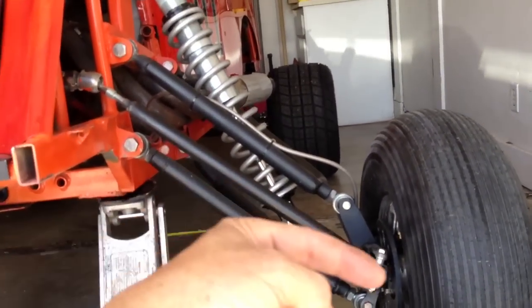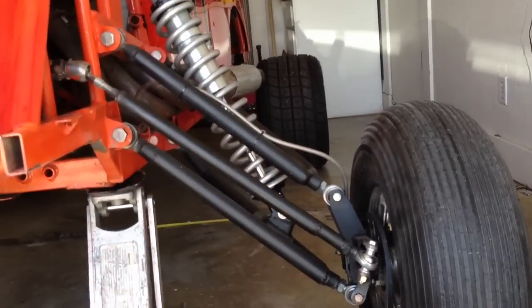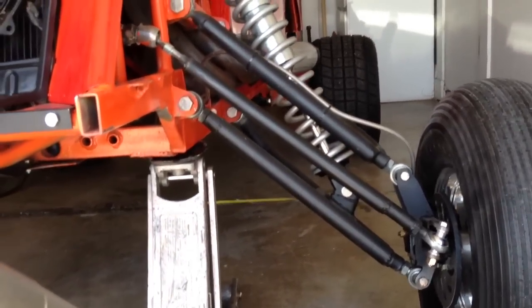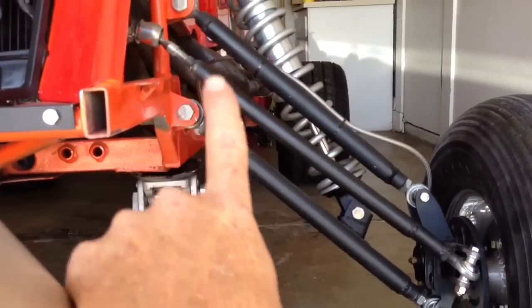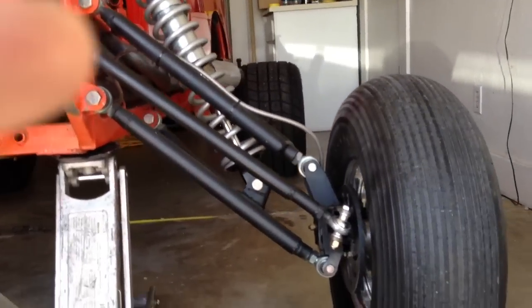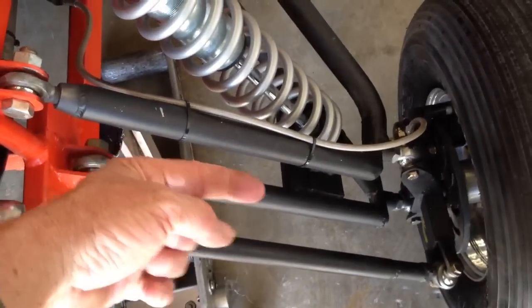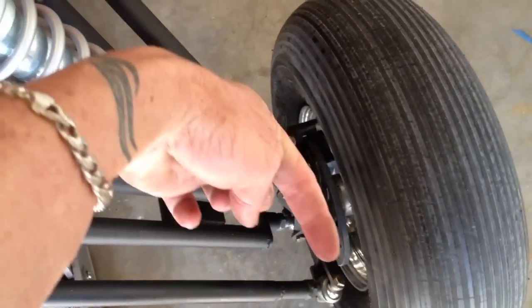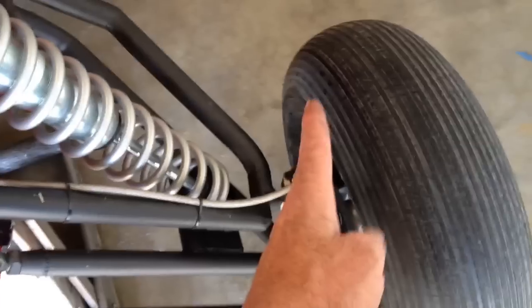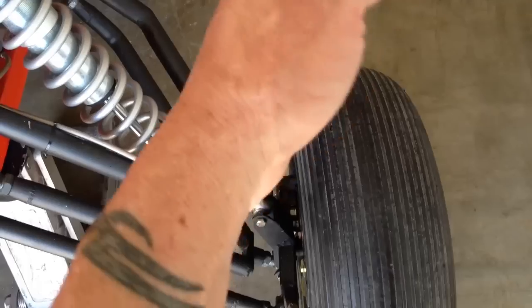You can see where it's kicked out just a tiny bit, but it's only the last inch of travel when you have this far of suspension — you're going to get that with that much range of motion. This is actually all the way up, but generally speaking there is an arc that goes between here. It doesn't matter if it's higher or lower. Also, the distance from this bar — the farther out the steering is on the spindle itself, the less steering motion you're going to get.